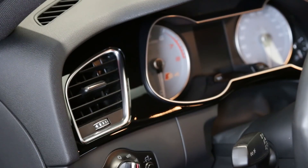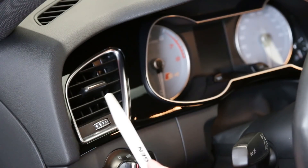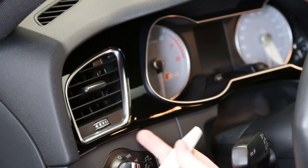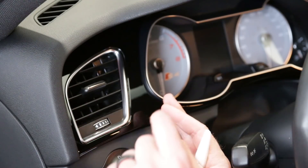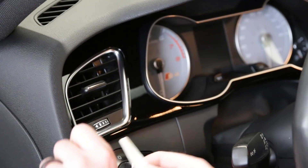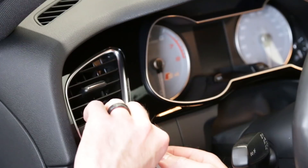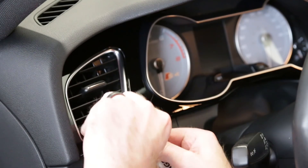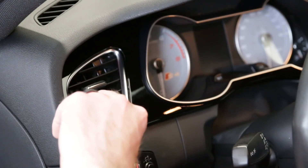There's not really a ton of tools needed for this, but we're going to start with this bone tool — this is a Volkswagen one. We'll link it in the description below. It's a plastic tool that allows you to get underneath trim like this. We are going to need to remove this dash trim, so we get underneath it and pop it loose — same goes over here.